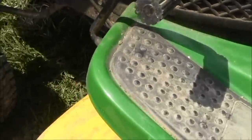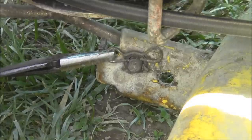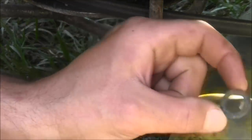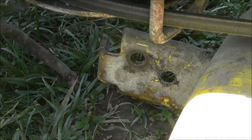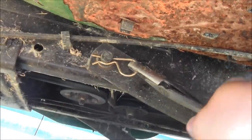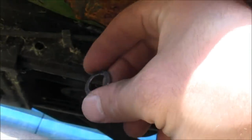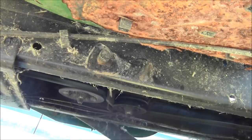We've got some rust there — we'll have to sand it off and spray paint it. Going over to the front side. Wiggle that one off, just remember how it went. Get that little washer off and slide this off. Now we're ready to get those other two parts. This is the other end of the first cotter pin I took off, so just take that one out and get that little washer off.